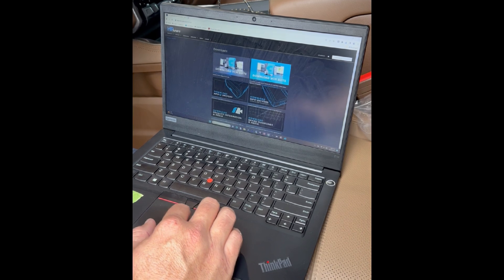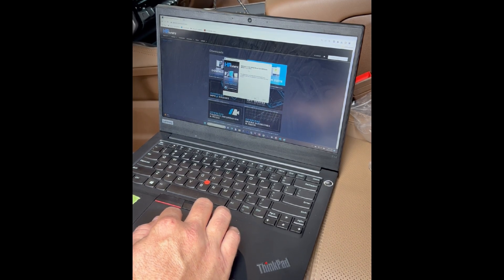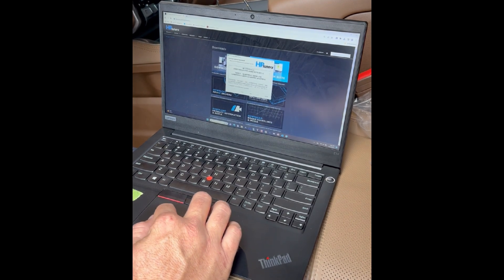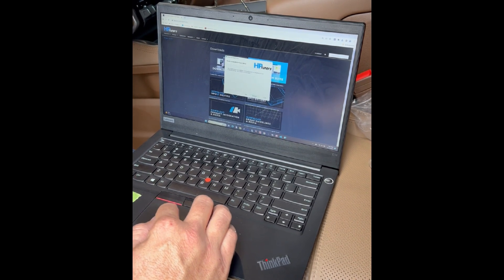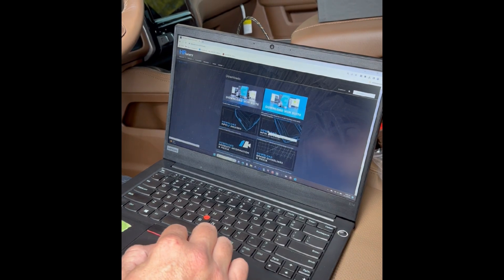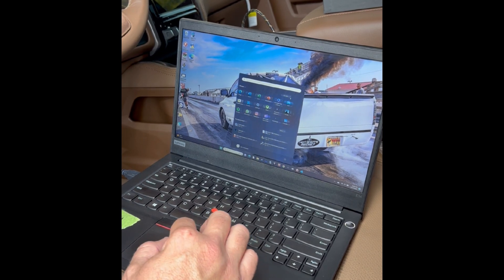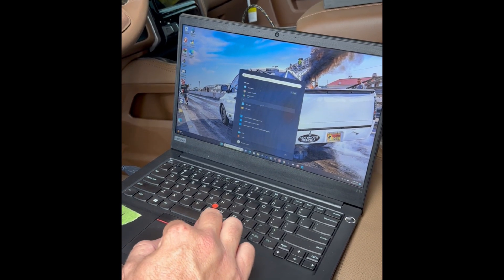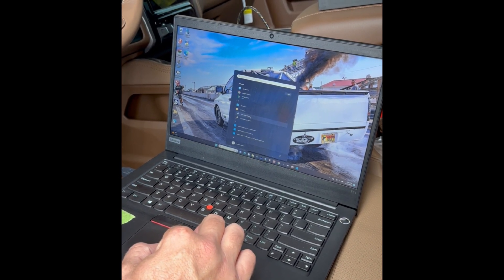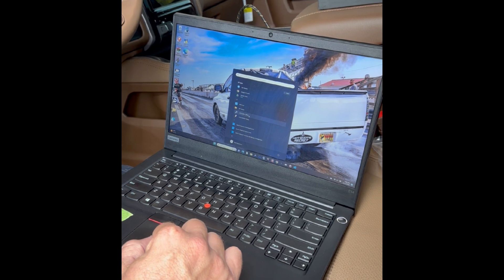I'm going to click on it right here. We're downloading version 5.1.1719 beta. We've finished installing it, hit finish right here. Go to our programs, all apps — this is on Windows 11. Scroll down to HP Tuners and click on the VCM Editor. Make sure you click on the one that says beta. If you have the standard version installed, installing beta does not overwrite it, so you have to make sure that you open the beta version or none of this will work.